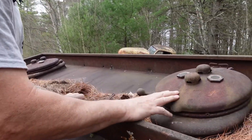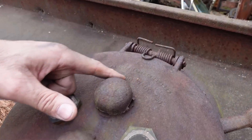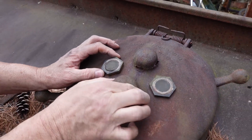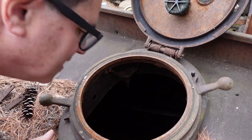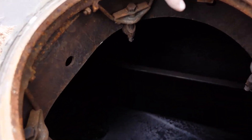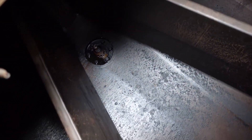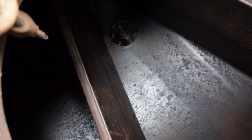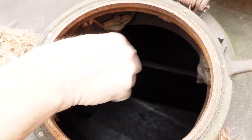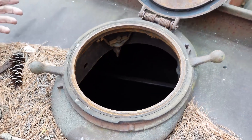But inside of these here, this hatch — it says it's cast iron, it's almost like a submarine hatch. It says Philadelphia Valve Company right there on this cast iron lid. And there are some viewports right here and vents. So let's lift it up. If you look inside, you'll see those V-shaped forms right there — those are baffles to prevent the oil from surging. When the truck accelerates or goes up a hill, instead of all that oil rushing to the back and maybe causing a wheel stand, that V-shaped structure inside, which is welded in place permanently, diverts the oil left and right and breaks up that momentum.